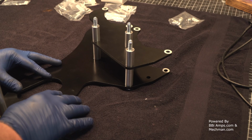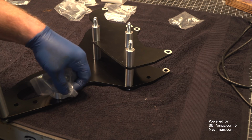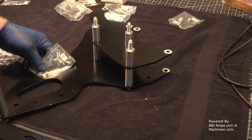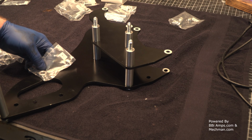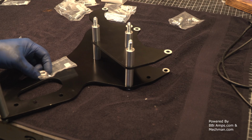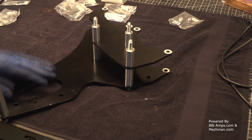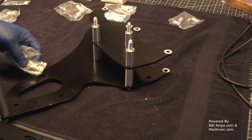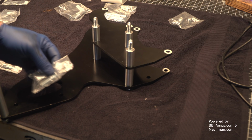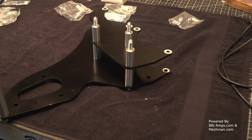This is where your power steering pump sits. You're going to need to put spacers B right here on this spot, another spacer B here, and spacer C goes on the backside standing off by itself. It's going to be really hard to shoot that, but it's going to be a little bit of fun to get these worked up in there, but we'll figure it out. Have faith. We'll get her slid in there. So just to know that, you're going to use bolts BC for this one on what would be the driver's side of the truck, and then on the passenger side of the mount bracket, opposite side, you're going to use bolts BB. Okay?